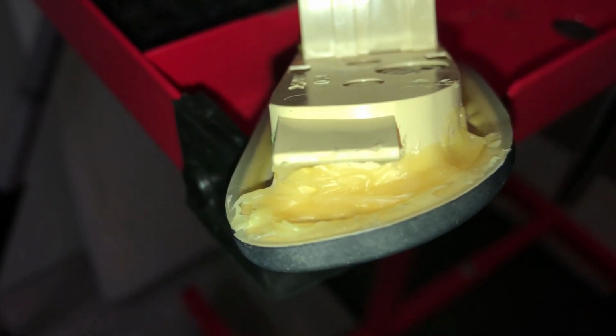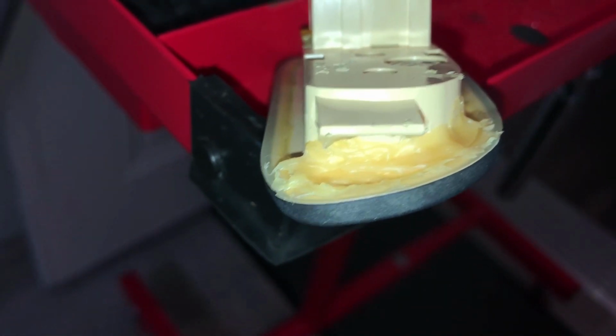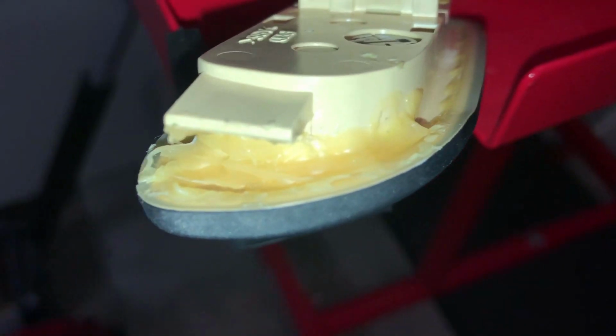Now let me angle this so I can get a good shot on it. Now this is the window repair itself. That's where that fat crack was. I went ahead and I filled it in all the way around so the crack is no longer showing. And then I put some on the outside just to add some structural integrity to the fix itself so you don't have to worry about it breaking again. So now that that's done, we can go ahead and slide this back in place, and it's like it never happened. Very solid. The plastic epoxy or plastic weld, whatever you want to call it, works really well. And then that will hold me off until I do my LED conversion.